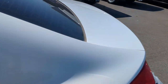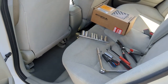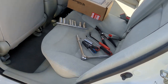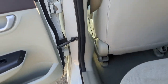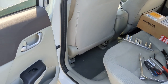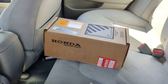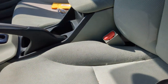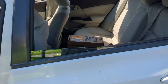These things will span a couple years. This video is going to be start to removing the seat belt — I'm not going to do the reinstallation of the new seat belt. We're going to have a few tech tips: one is removing the back seat, two will be removing the trim panels along the bottom and the B pillar, and the final one will be accessing the seat belt and disconnecting it, getting ready for replacement. Here's our brand new seat belt straight from Honda. You can buy used parts if you want, but when you're dealing with airbag stuff it may actually benefit to have a brand new part, though obviously you're going to pay more for it.